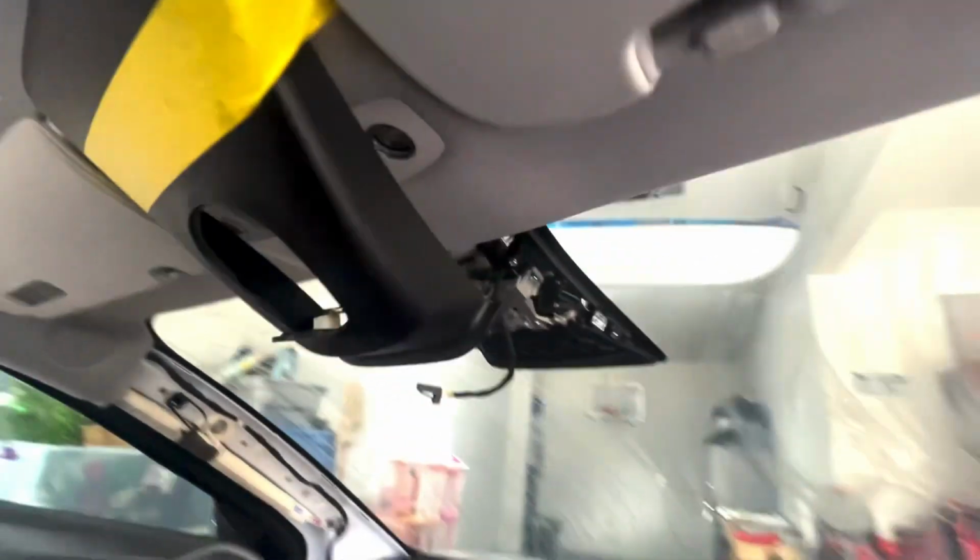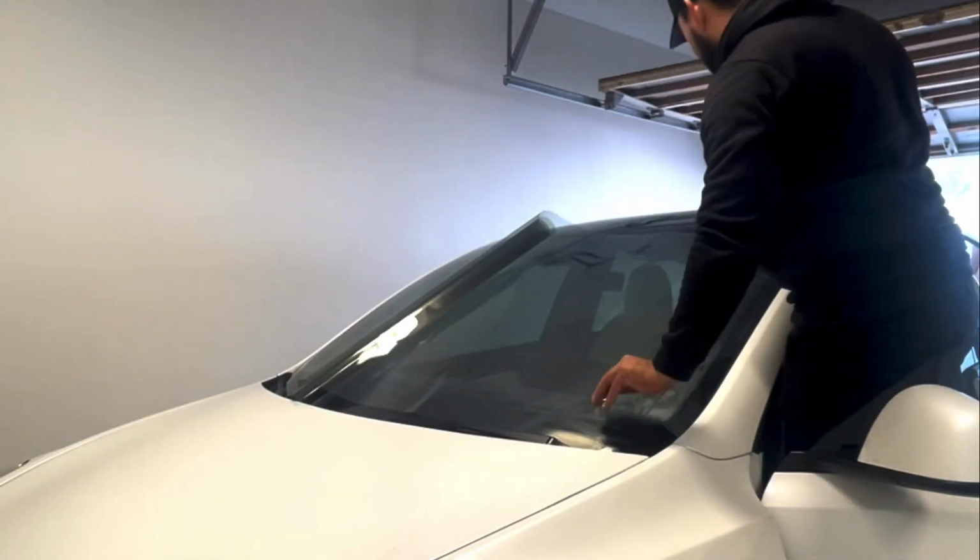It is going to be tucked in behind the headliner, so you want to go ahead and just wiggle that out. I go ahead and just tape it up here since I don't remove that other wire that's stuck on there. You want to remove these 2 T10 Torx screws. This is how it'll look once everything is removed. Super spacious now for the install.